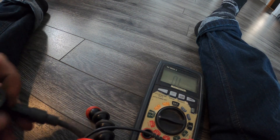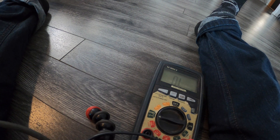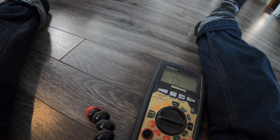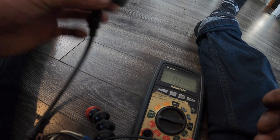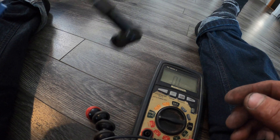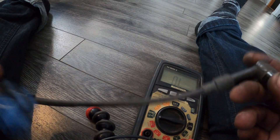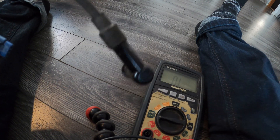I've actually got one out of four that has a bad plug wire. You can see it going up to 10.9k — so 10s and 11s are good numbers to have if you're testing right at the plug cap. Anyway, that's what I conducted for this test — I hope it helps you guys out with some of your troubles. Maybe we'll do some more tests in the future.